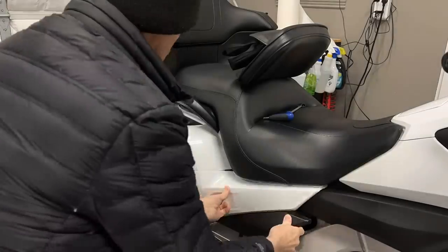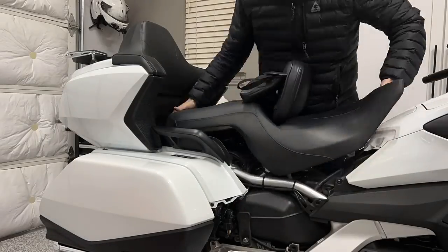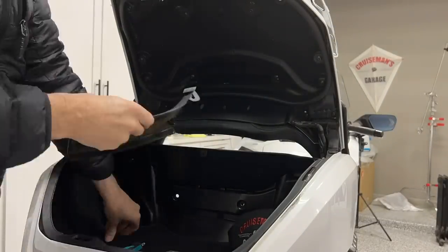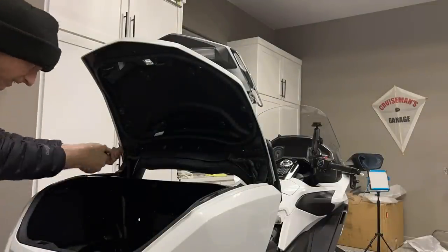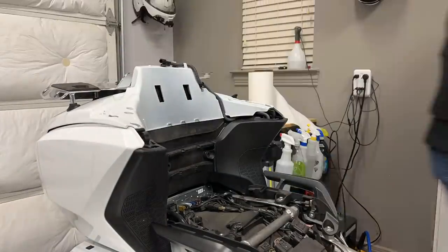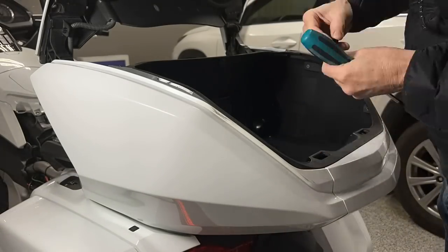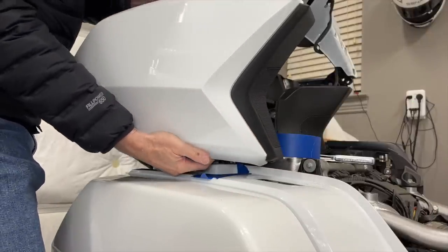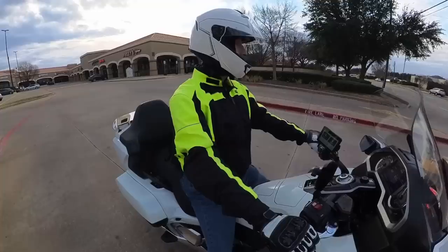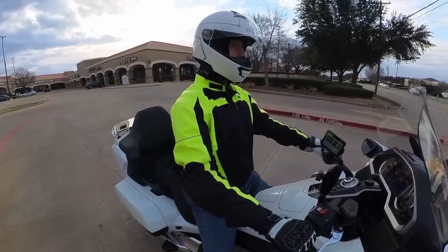Back to the trunk. I decided the easiest part to remove would be one of the trunk side panels. So I went to the garage, put the bike on the center stand, and removed the right side trunk side panel. On the 2018 Goldwing you've got to remove the seat, the passenger grab rail, and then the passenger backrest before you can remove the side panel. Thankfully, Honda did make removing the trunk side panels much easier on the 2021 and later models because you no longer have to remove the speaker cover along with the side panel — it's just a much better design.